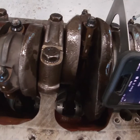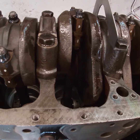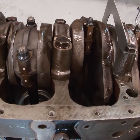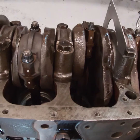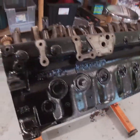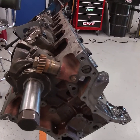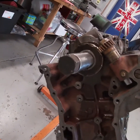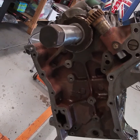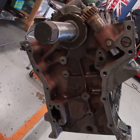They can't go the wrong way around because they're doweled differently across the engine, but you want the right bearing cap in the right place. They're all basically like that. That tip came from one of the videos I watch — I'll mention it in the write-up a bit later today. I'm always nervous about getting these bits wrong, so I've spent quite a lot of time checking to make sure I have it right. Now I'm going to carry on, reassemble the rest of the pieces that go on the end of the crankshaft, and fit the timing chain assembly hopefully today.